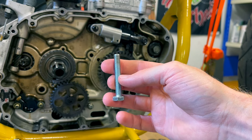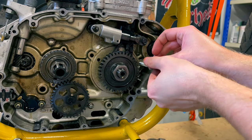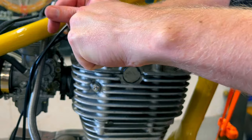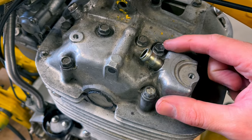Here is a neat little trick: you can screw an M8 bolt right here to lock the flywheel. Just don't do it up too tight, and remember to unscrew it whenever you turn the engine. Don't touch this bolt.